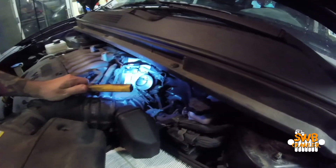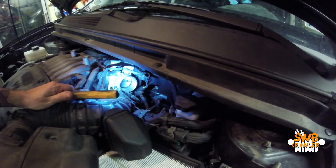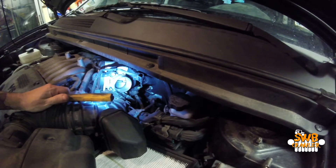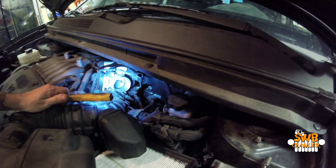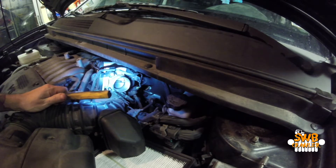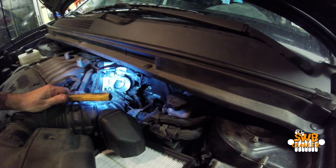This thing has to do with emissions. The EVAP system is usually collecting evaporated fuel and doing something funny with it. In this case it pushes it into the throttle body, so the fumes get burned up the same way that the fuel does, which makes sense. Anyway, I'm gonna try to get this thing disconnected and we'll go from there.